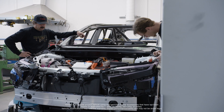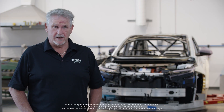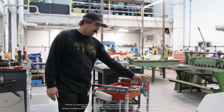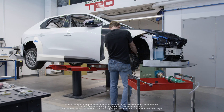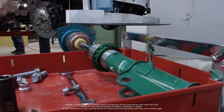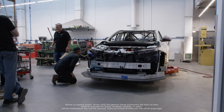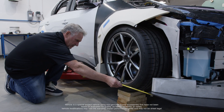Right now we're still waiting on shocks to show up, which is a huge stress because of customs — it's supposed to be shipped today. We have a Camry shock from the same company as a reference. The top plates are different, but if we take out one of the studs it will fit in place. It allows us to travel the suspension far enough for as low as we'd ever want to get the car, and we confirmed that at full bump in the corner we can still make full steering lock without pushing the fender off.